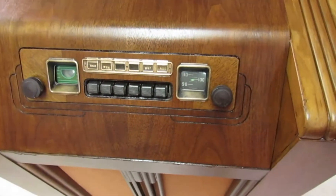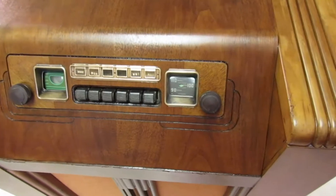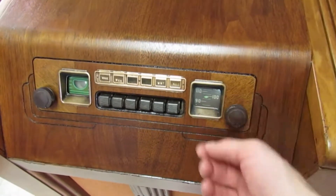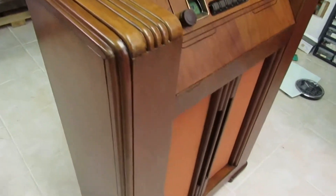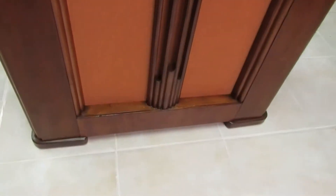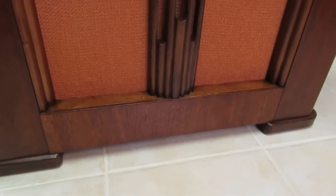There was a missing piece inside that actually connects the knob to the dial — you have to push it in and turn it to get it to go. The cabinets have been refinished, mostly just stripped and repainted. There was some really severe damage at the bottom, and a new mahogany plate was put on for that. Brand new grill cloth — looks spectacular.